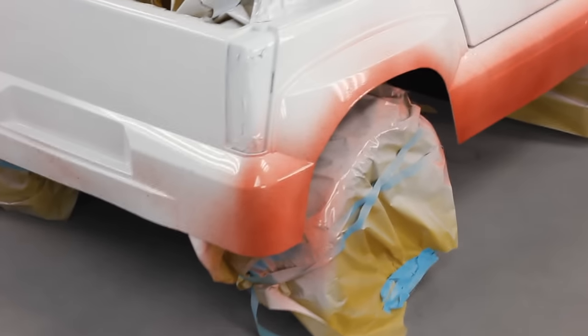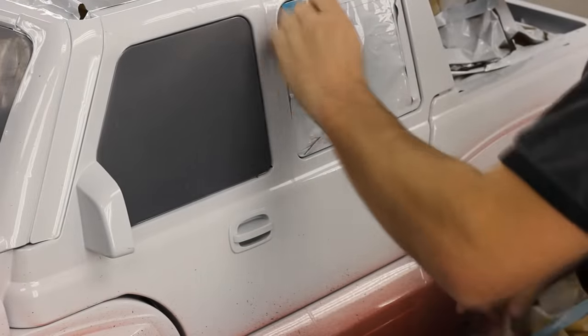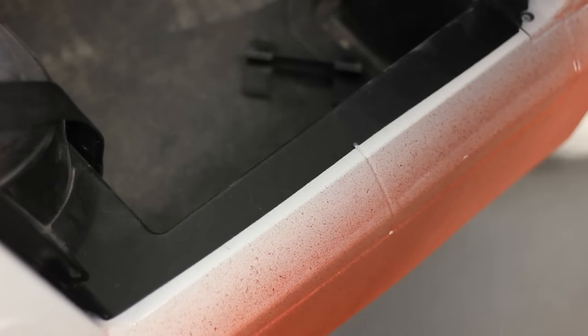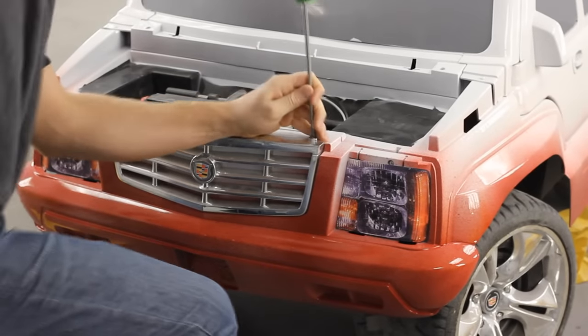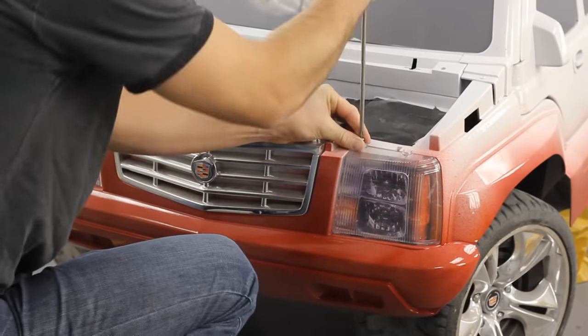Here's what she looks like off the gun. After letting it dry overnight I am ready to unmask it. Here's the jam line on the inside — you can see I have a nice clean edge, which indicates pretty decent adhesion. Plastic is one of the most commonly failed things you can paint, so make sure you've developed some very good plastic prep routines. Then of course I need to put all of my trim back together — the grill, the headlights, and anything else I had disassembled.